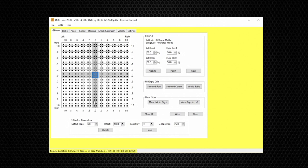In this example the Default Rate is 6% and as you start in the G table it is 50. So to go from 6% to 50, the g-force rate of change — such as when driving in a slalom or making a sudden lane change — must exceed a certain threshold represented by the Sensitivity value. The lower the numeric value, the more sensitive it is. To make the suspension stiffer with less movement from the driver, decrease the Sensitivity value — typically by 5 is a noticeable difference.